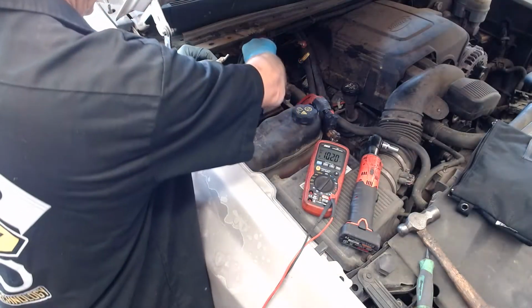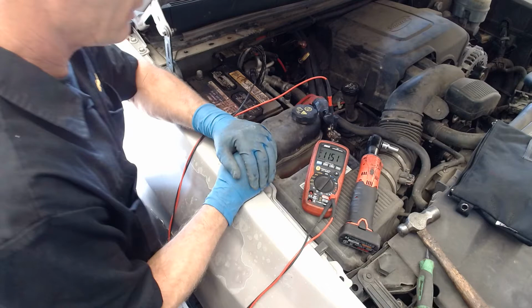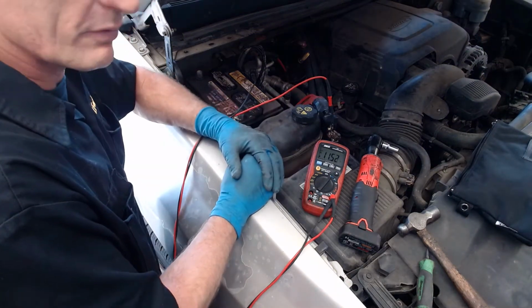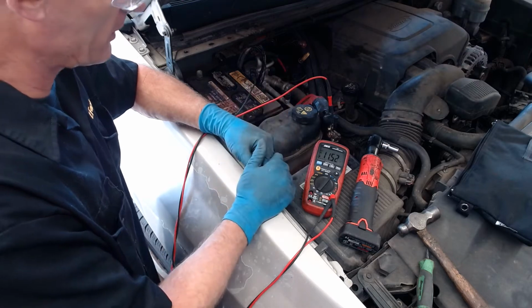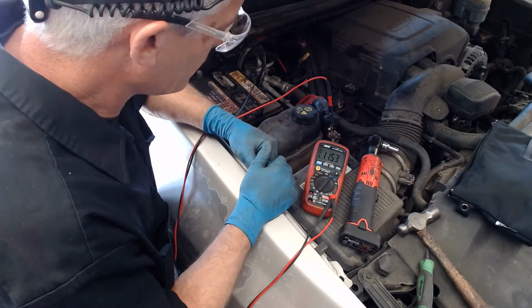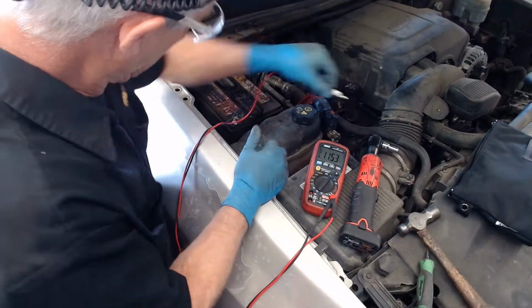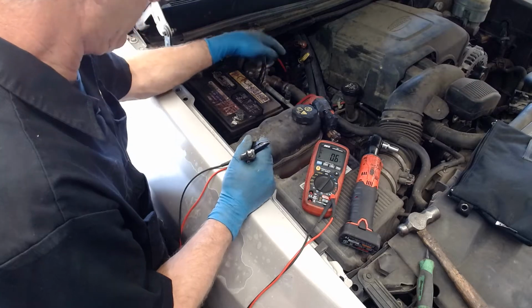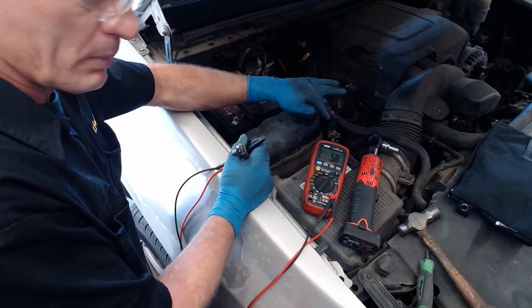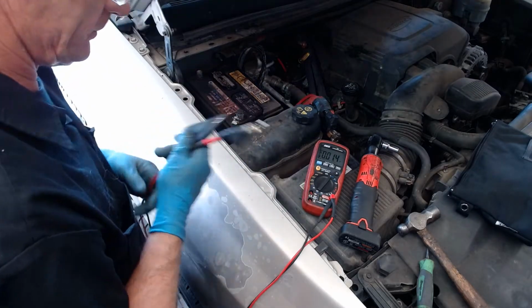But now if I go to these cables, what do I see? Hey, I see 11.53 volts. So my battery saver's working. Just that my jumper pack's only got 11.53 volts. That's okay. But it is working. It's powering the system. But again, it's going to be important, especially this positive. The negative lead can touch ground because it's already attached to ground. But the positive lead, it's important I don't let that touch anything metal right now.